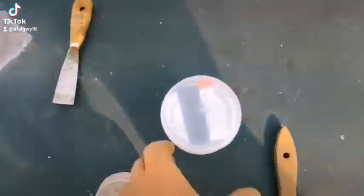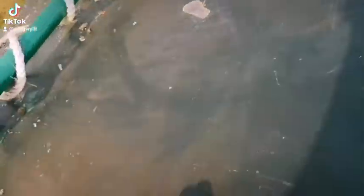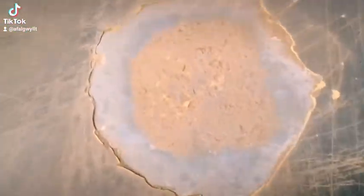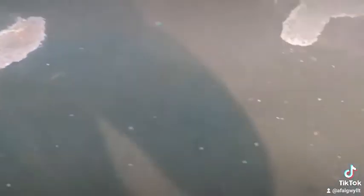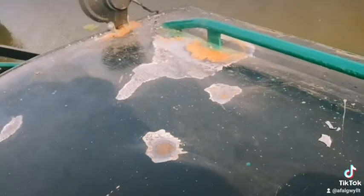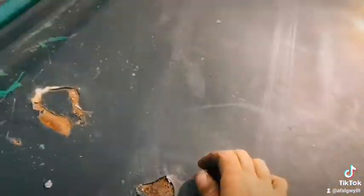What I'm going to do is use some big boy metal filler. Doesn't have to be the metal version — can just be normal big boy — but I chose metal because this roof gets quite hot and I thought it helped with temperature changes. I've got a little bit here and a little bit here that I'm going to fill in. I'll fill all these in for now and do more of the other holes another time.